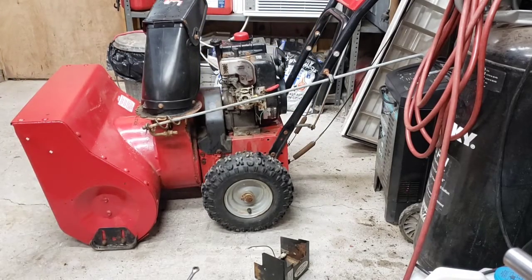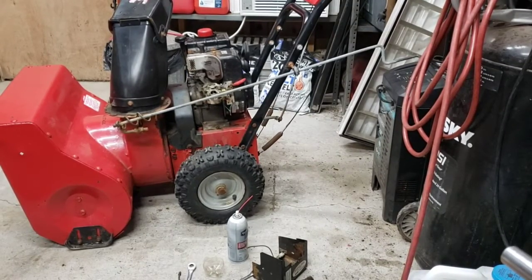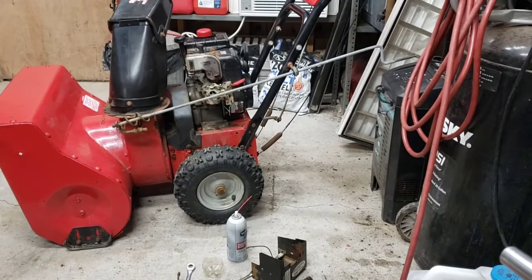All right, you see me clean 1,000 bowls. We're not gonna film this one. We're gonna pause it. I'm gonna take that bowl off and see if it's dirt in there. All right, carburetor, we cleaned a little dirt in the bowl, a little water. Running a little bit better.